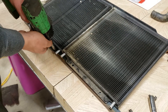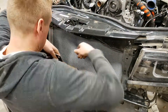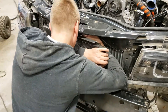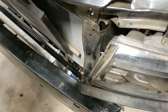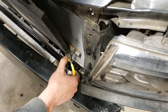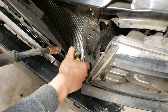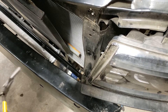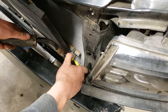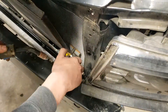First thing I did was tie the two coolers together so I could get them up into the car and mock them up and see how I was gonna get the angle done. You can see here I already have the top bracket done — it bolts right around where the hood latch goes and uses factory holes there. The bottom I'm just gonna tie it forward to the intercooler mount that I made in a previous video, and that'll just keep it from flapping around in there, spaced away from the condenser and from the intercooler so they're not rubbing up against each other.